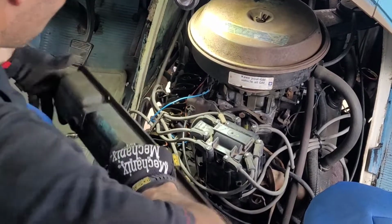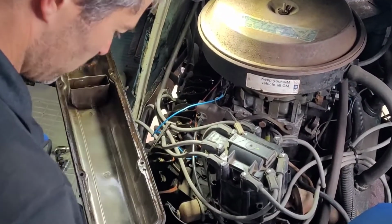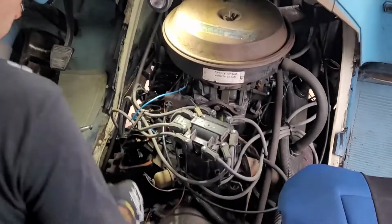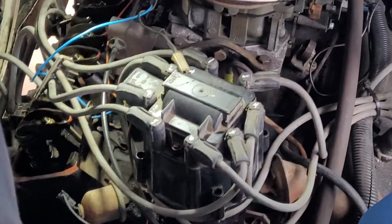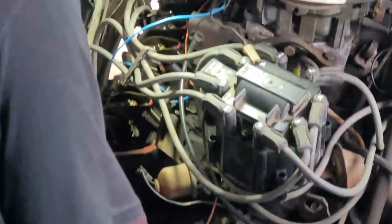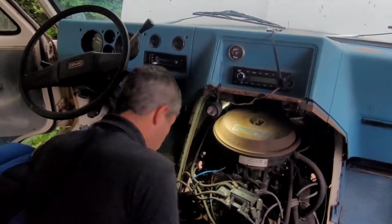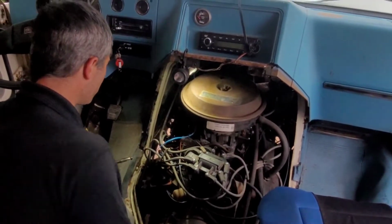There you go. And there's your cork gaskets. Cool. Okay. And I was wrong though. Someone else has been in here because there is evidence of red silicone. It may have been leaking at one point, and that's what they sealed it with. Silicone and cork doesn't mix, so I might actually end up having to buy valve cover gaskets. It's never a bad idea anyways, right?